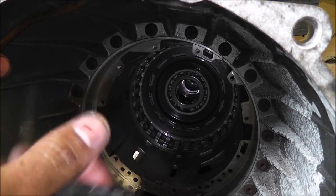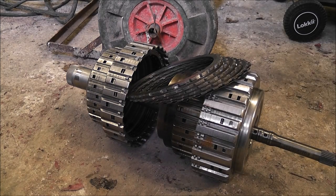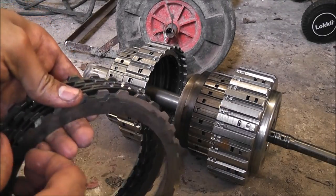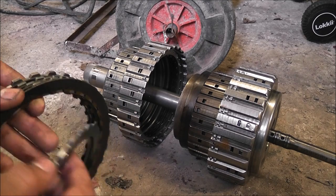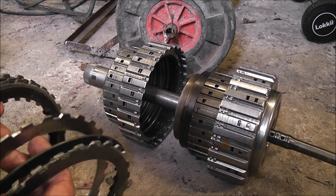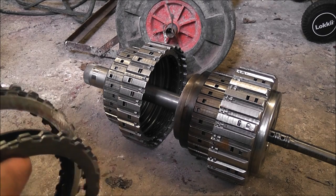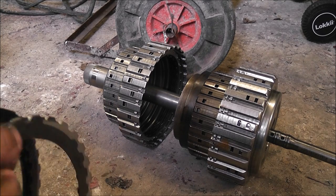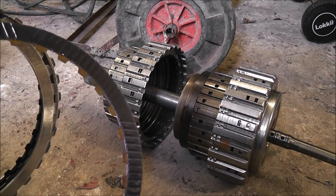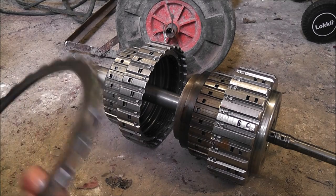Some clutch plates — so these are the clutches. We have here the clutch plates at the rear. Within this we have a really thin one, then the metal clutch face, some pad — a friction plate — another one, another piece of metal plate, a little more friction material. To say that this gearbox has done a hundred thousand miles, it actually looks really really good. You can still see the teeth on this friction material clear as day, no imperfections whatsoever. It's absolutely smashing. So yeah, keep those together.